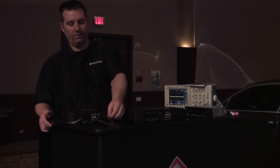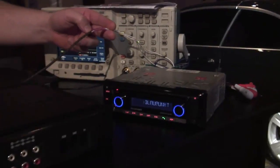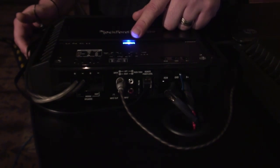So as you can see in this case, there's no remote wire connected — just this little jumper so you can see it. I'm now going to turn this radio on, and we have it hooked up with speaker wire through this RCA. You can see now the amplifier turns on. What it's doing is sensing the 6-volt DC on the speaker wires, allowing the amp to trigger on.